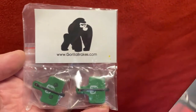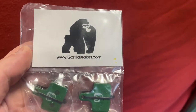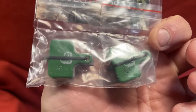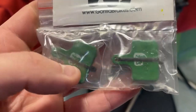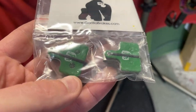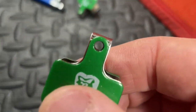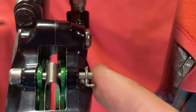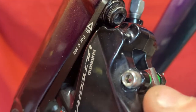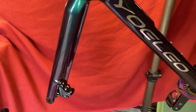One last thing we've got to do is put in the brake pads. The brake pads we're going to be using are from tiebike.co.uk, gorillabrakes.com — these are ceramic brake pads. They don't have cooling fins, but I found these work really well with the Dura Ace and Ultegra discs. They've got a spring, so we're just going to put them in and put the bolt back through the hole — dead easy. I've just realized these pins might not be the same as yours because I bought these because I didn't like the supplied Shimano ones, but they do the same job. So that's the calipers all done.